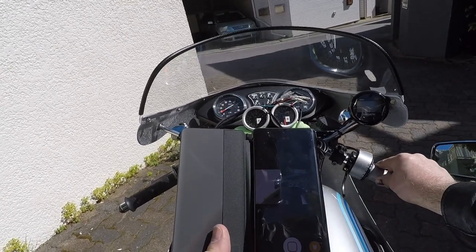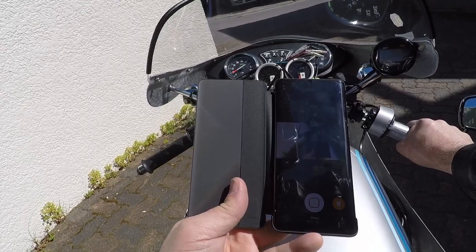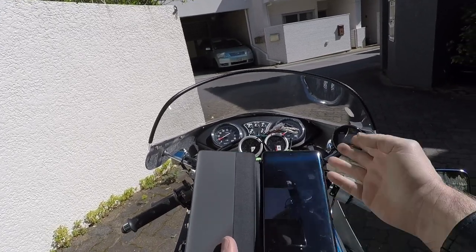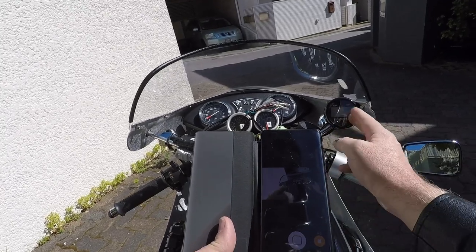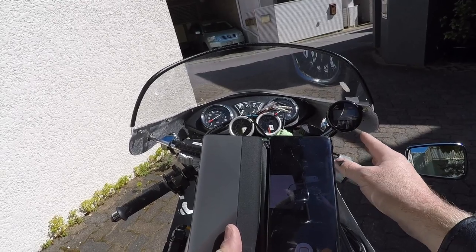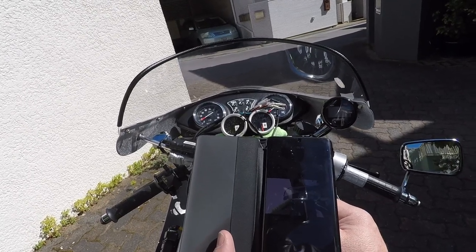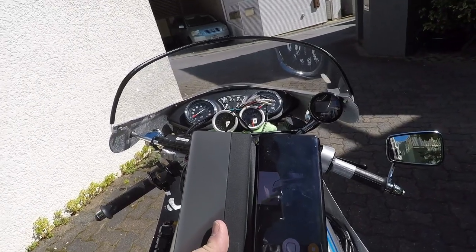I'm going to ride it at different throttle settings. The main one I'm interested in is right there, and then winding it on a bit. It runs well everywhere else, so I'm just going to concentrate on that, but we'll see what happens on the instruments. We're looking for 14.7, which is perfect, but that's not where you actually run bikes. It might be somewhere 12, 13 that we're aiming for. 6, 7, 8, 9 is too low. Over 14.7 is too high.